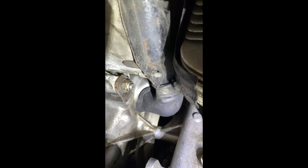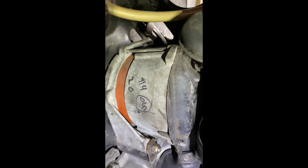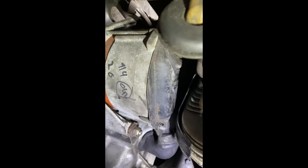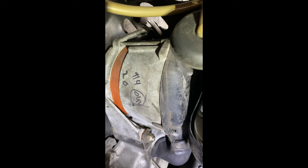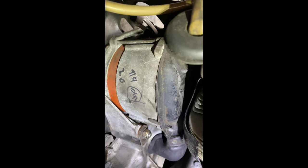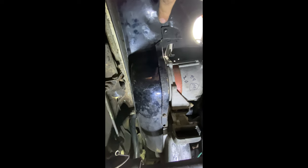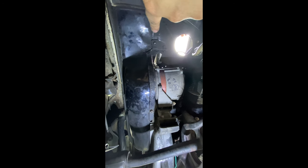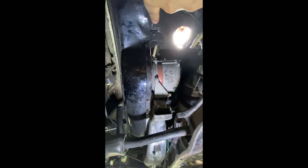It just takes a little time and patience and a little bit of a long screwdriver. Get in there and make sure that it's pretty free and has some movement so that your airflow is not restricted. We've got that bottom bolt tight. I might go ahead and put in that top pivot bolt while I'm down here so I can see both sides of it. Then we'll go put on the tires and tighten the belt, get it kind of where we want it, and then pop that tin back in. There is one tin bolt from the bottom that we've got to do, and then we'll start reassembling tin from the top and heater exchanger stuff from the bottom. It just takes some wrestling — it really takes two people to get this tin in. You need to be above here, inside of this front shield case, and below that piece that crosses the engine. You have a tin bolt there and there, then two from the top, and a couple others. We're going to start popping the heater setup back together, then go to the top, put the belt on, and check the voltage.